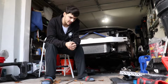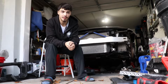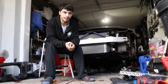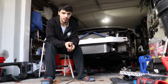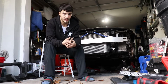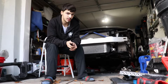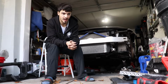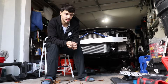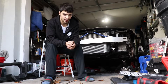Yeah, rod bearings, that's an issue. We're also having front suspension issues besides the bearing thing. I can't pinpoint where it's at. I think it has to do with the way the bump steer was installed, because I didn't touch the front suspension. I only rebuilt the rear, so the front was installed by the previous installer, and I wasn't having that many issues. The only thing that was really touched were the bump steer rods. And I get a little bit more turning radius going right than left.